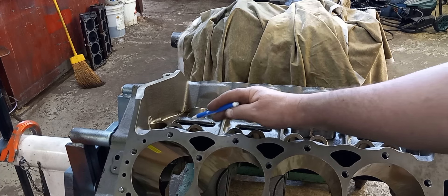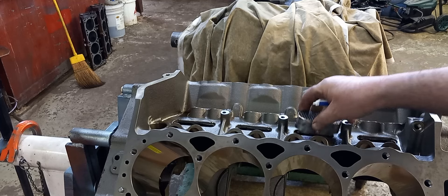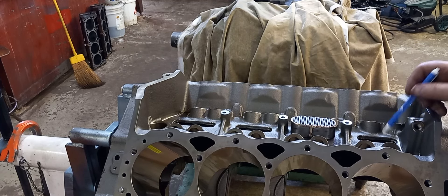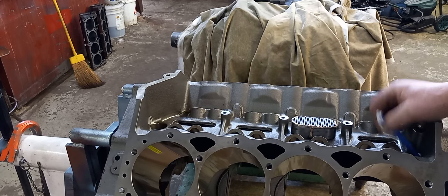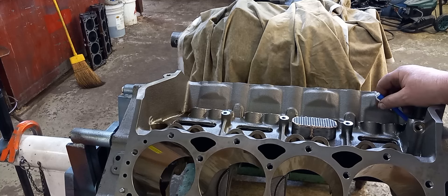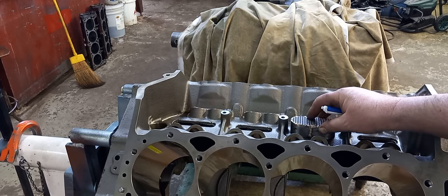The back ones I'm going to leave part of the back open with screen so the oil can go back and drain back there. I've put a hole here in the block — two of them — to the front cover, so oil can drain back there. That's kind of my thinking on it, and I'm going to get going on making these.